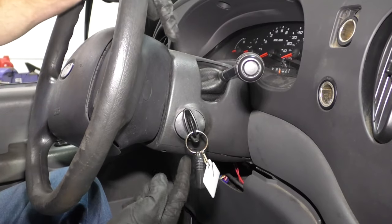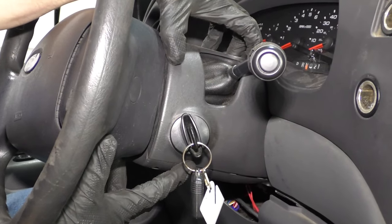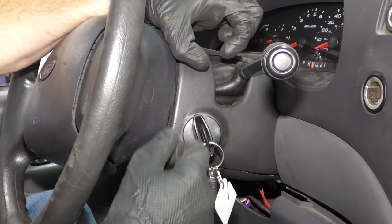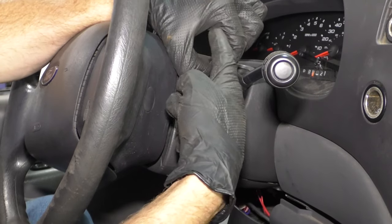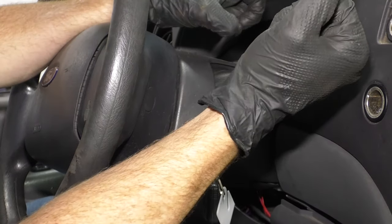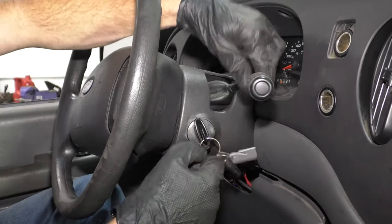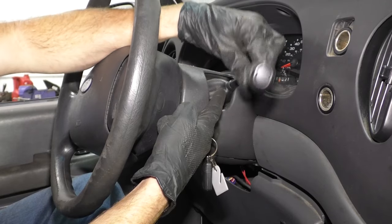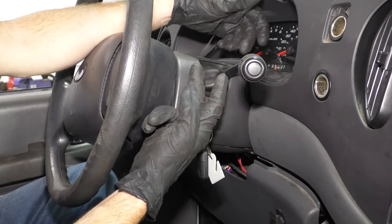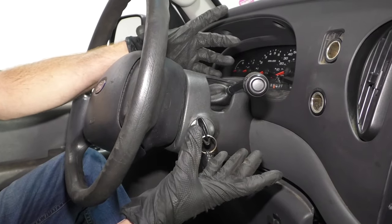The causes for this are located right inside your steering column — you'd have to take a whole bunch of things apart to get to it. In between the shifter piece and the steering column itself, there's an area where they connect with a little plastic bushing in between. Over time, if you try to shift without properly pulling and then pulling it down, you're going to put a lot of wear and tear on that plastic bushing. There are also a couple of pins in there that need to be replaced as well. Usually you can get it as a serviceable kit.